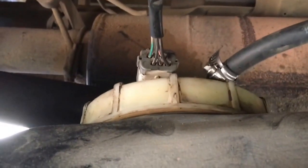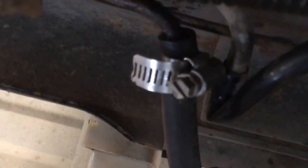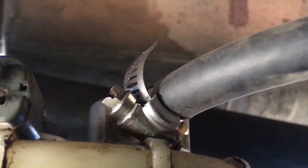Okay. We got our plug last night. I have the tank sitting here, wire harness plugged in, the return line is set up. As you can see, I cut the line and spliced it with the new hose from the Larry B's kit. And I do like the fact that I did buy that, because I like the way it sits on top of that sending unit much better, seals in there better. And next, throw the tank in, and then we install the other sump on the bottom.